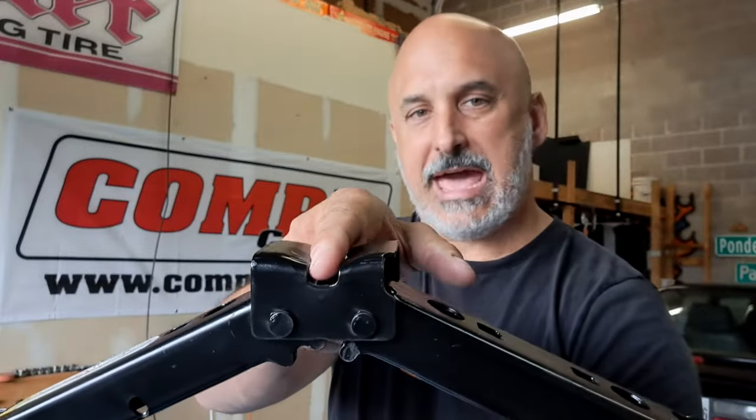In this video I'm going to be showing you the jacking points for a Ram 1500 if you're using the stock jack. The stock jack's top pad has a slot in it. That slot is there to accept the jacking tabs in the rear and to slip into a ridge in the lower control arm up front. Let me show you what that looks like.